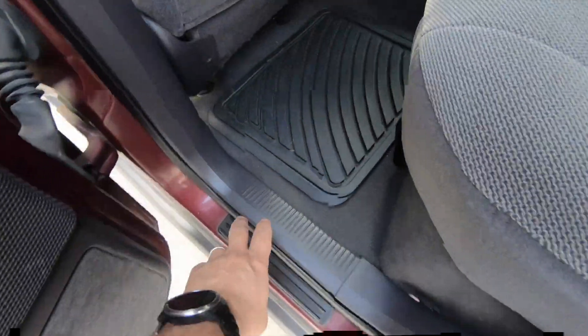We'll utilize the existing clips in here. This is actually a ground and a power, so we're gonna have to separate those and I'll use this little adapter. The wire loom in here is quite full so I'll be struggling a bit to get this video cable in through there. What I had to do was cut a little hole in this little rubber gasket, and I'm gonna seal this up with some room temperature vulcanizing silicone so it doesn't leak — and I'm gonna do the same thing on this one on the top here. I just put two little holes in there, squirt some RTV silicone sealant in there, and that should seal those up from the weather.